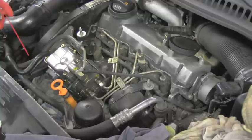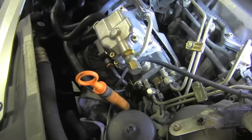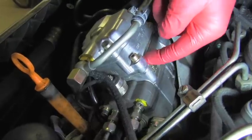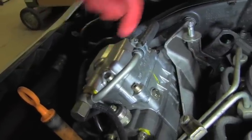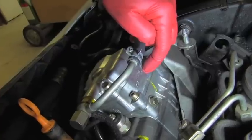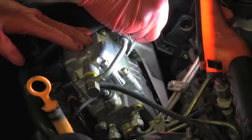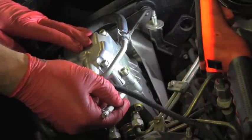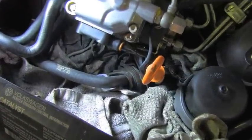When you work on diesel injection in general, it's extremely important that you keep everything clean. I start with cleaning. In my case the fuel is leaking from this area — there is one seal here, this is the top seal and this is the second one. So I'll only be removing the top cover and then this part, the quantity adjuster. Before removing the parts I will use something sharp to make marks for future alignment — one here and the other one right here. I placed rags around the pump to catch the spills.